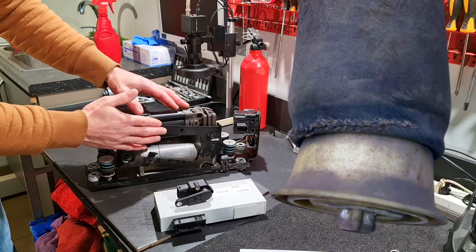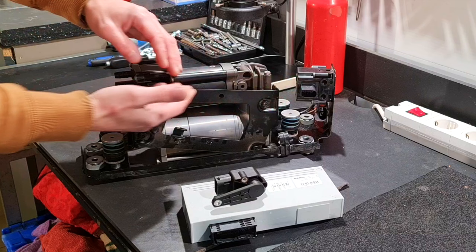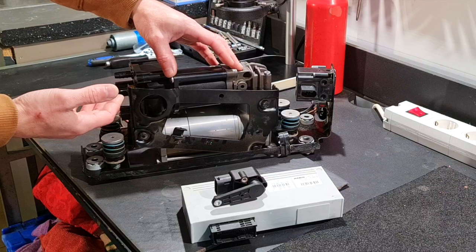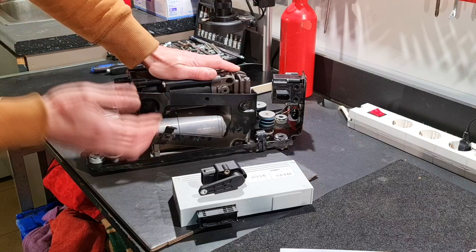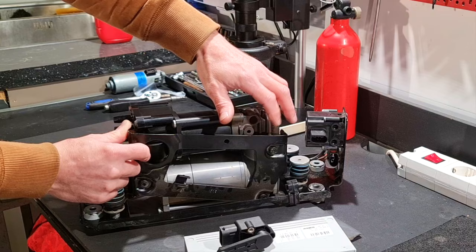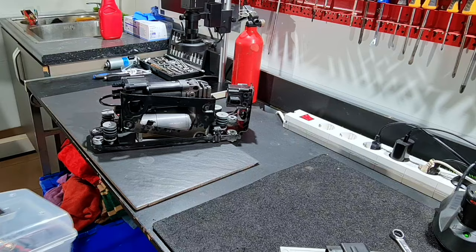When this process is interrupted, the air dryer will become full of water because the air compressor will send dry air over and over again to inflate that air spring. No more dry air will be returning to take out the humidity from the dryer, so the humidity will become water and the water will destroy the discharge valve and solenoids. From my own experience, most cases the discharge valve will fail first, then the solenoid block valve, then the piston rings, and very rarely the electric motor. Now I need to completely disassemble the system and find the problem. First step, I will make a short test.